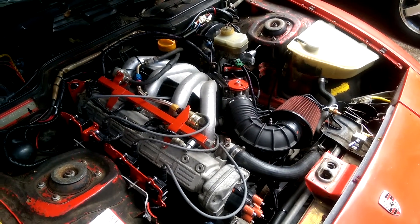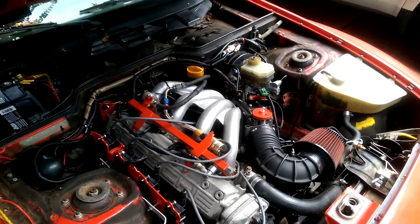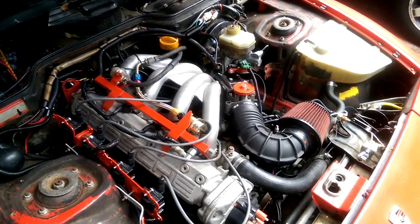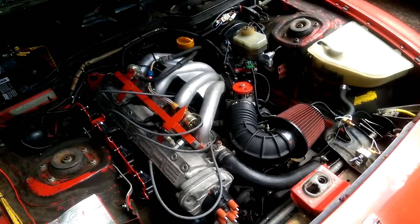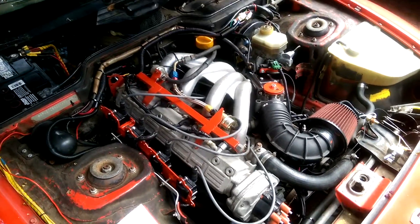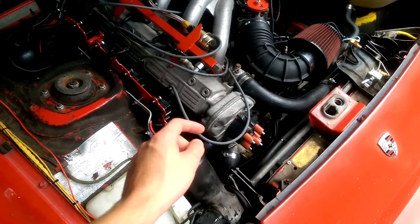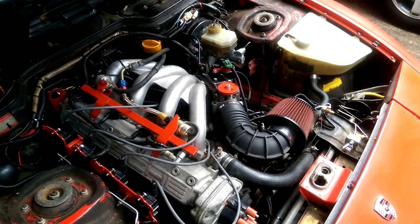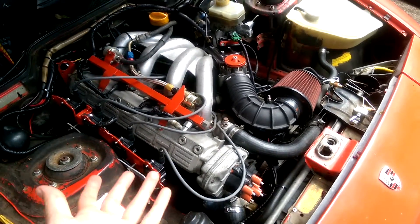I want to make a quick video. I said in the last couple of videos that I wouldn't be making any more, but here I am. There's been a couple of improvements made. In the last video, the old harness was still in here alongside the new, and I was having problems seeing how I could maintain some gauge functionality like the oil pressure gauge, the water temperature, and tachometer, because the DME harness had those runs in it to complete that, even though it didn't have anything to do with Motronic.